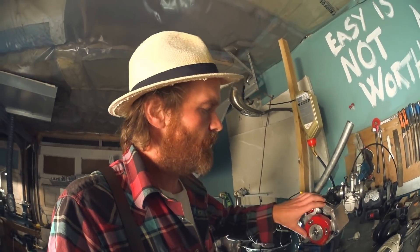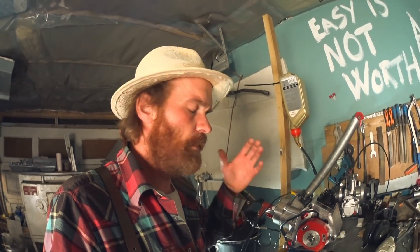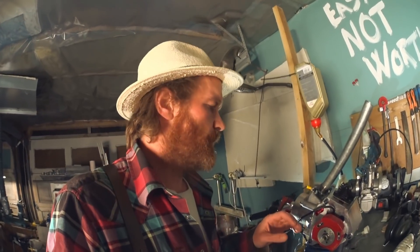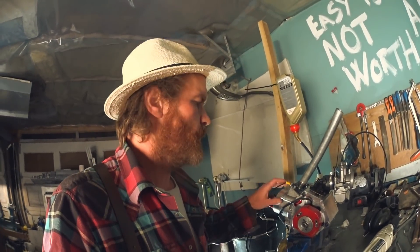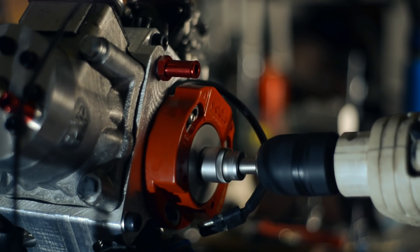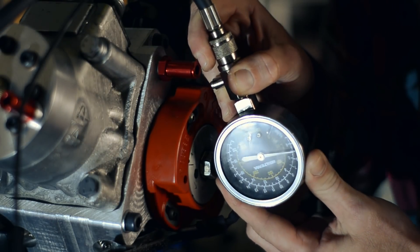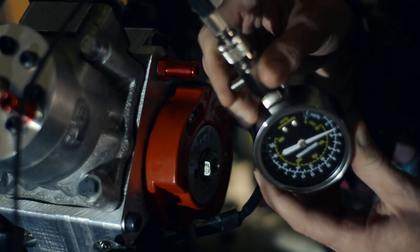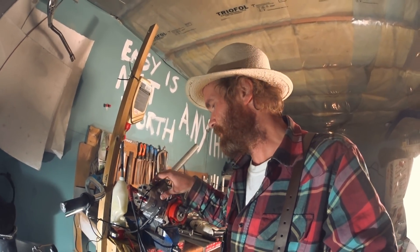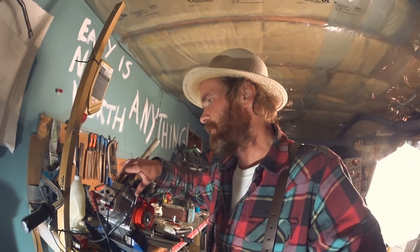Let's check that compression. It doesn't really matter at this point — we know it will start and run and rev with this massive crankcase. We know the ring can seal and we know there's an improved ring in the making. Let's do the test. Compression remains the same: 75 psi. Which means we can continue testing as it is, as soon as I get those O-rings. My O-rings haven't arrived yet, so I can't fill it up with water and do more testing safely.